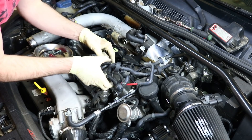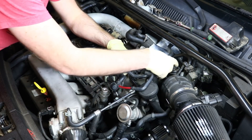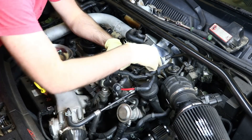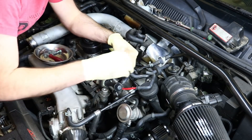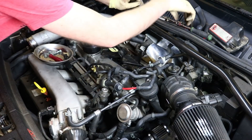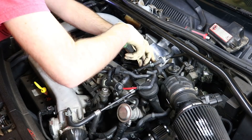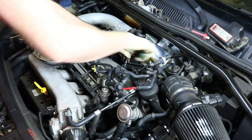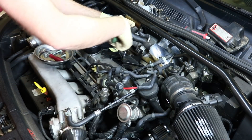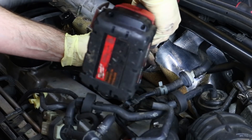You can remove this from the top of this diverter valve. This is actually the original diverter valve — you can tell because all these clamps here are original one-time use clamps that generally would get replaced. So most likely that's the original diverter valve, which is kind of surprising. Take this 10mm bracket off here, and then the rest of these are all 5mm bolts holding all of this stuff down. Now anytime you're taking out these kinds of bolts, you want to make sure you note the length of them, and if any of them are different, make sure they go in the right place.